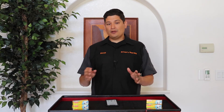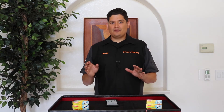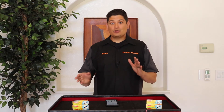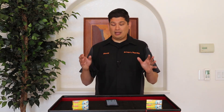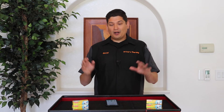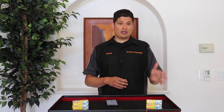It was about that time frame that I needed to change out my plugs. And guys, this is just fun automotive history — back in the day, if you'd go into a gas station and get a tune-up, it was usually oil, air filter, and spark plugs. The reason why is spark plugs were copper — just disposable — and a lot of people replaced them every oil change. People would get their car back and say, the car's running great, I just got a tune-up. Spark plugs make a huge difference; they really can dictate if your car is running good or bad.